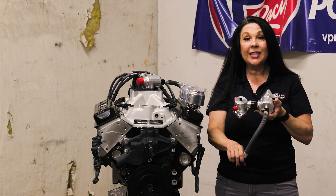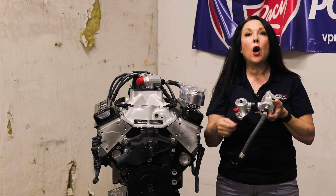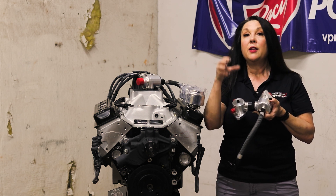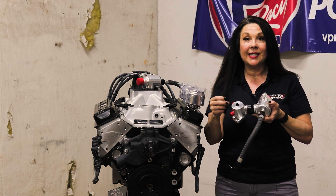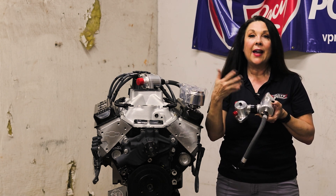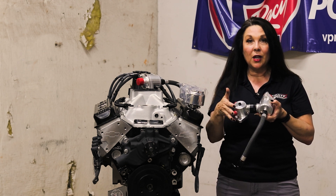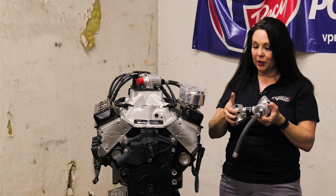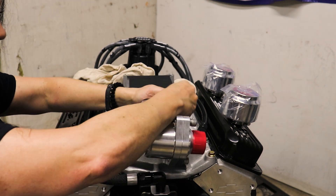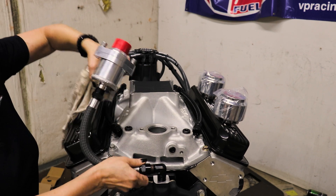With this going back into the water pump, what that is doing is recirculating that water. It is making it so that instead of your water pump just being full of water — if you've got a deadhead thermostat system, that water is just sitting in there and that pump is continuing to pump, and that pump can cavitate. So what we want to do is prevent that. We want to have continuous flow throughout the system, and that is what this will do. To install this, we'll just put a gasket on the top of this water outlet, set this on top, and then this hose right here is just going to connect into your water pump.